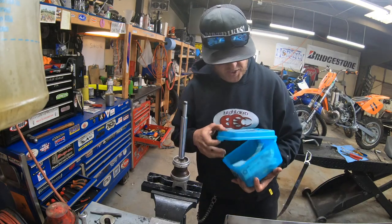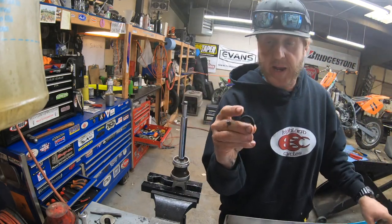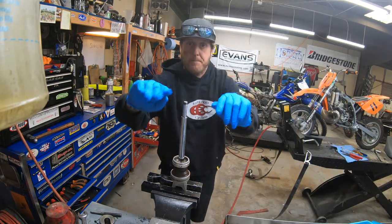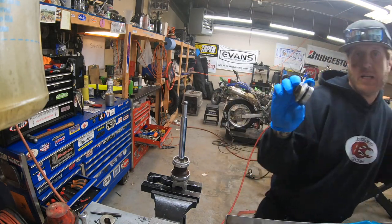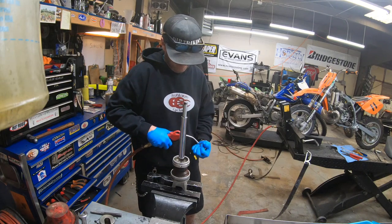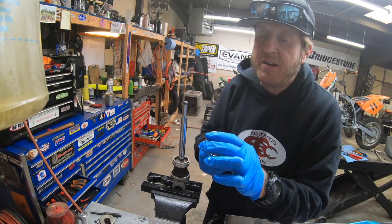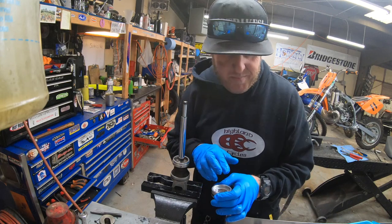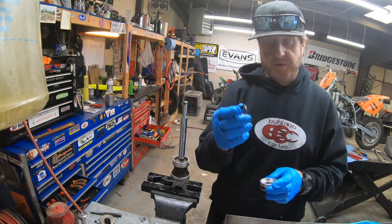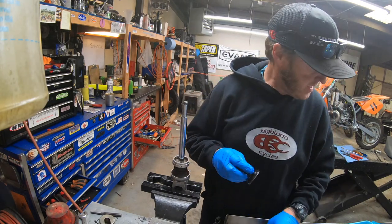There's our shock box, there's our little bolt with the rubber gasket. Now we're going to our 18 millimeter shock seals. Clean this thing really good — be careful because there is a washer/shim kind of thing down in there, don't lose that. When you get it off, take a good look at the bushing in here. This one looks great, but replace it if needed — I stock them. It's one of those things not a lot of people stock, but we keep them here because they wear out and they're inexpensive. New seal — just drops in like that, super simple.